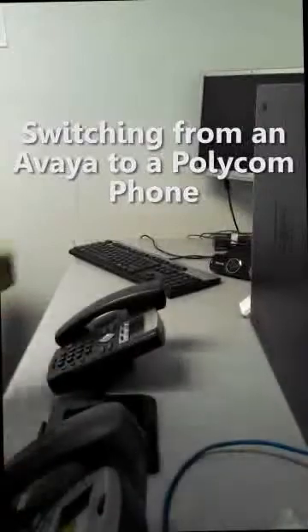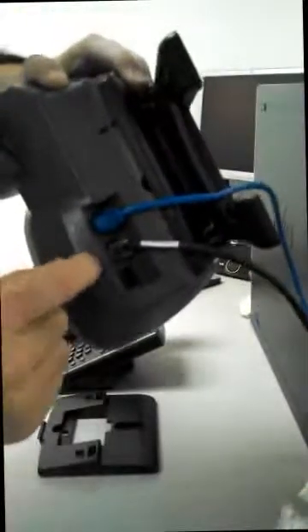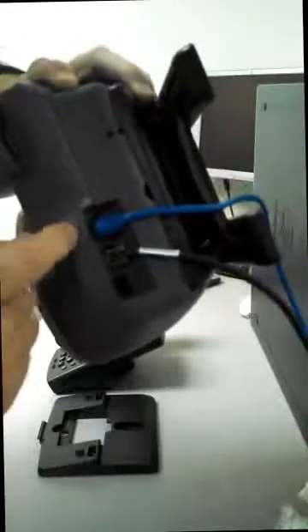For those at offices that already have Avaya phones, you will not have this extra box and will not need the power supply. You're going to take your Avaya phone and look at the top of it — there are two faint symbols. One is supposed to be a PC, a box with a little line under it. The other is a square with a little tab, indicating the wall plate. We're going to unplug the one from the wall plate, and that will go into the LAN jack on the back of the new phone. And the one from the PC port will go into the PC port. Do note that you will not have any connectivity and it won't ring like your Avaya phone until we make the full switch. You can plug it in and play with it when you are not taking calls, but once you unplug your Avaya, you will not be taking calls until we get this one set up.